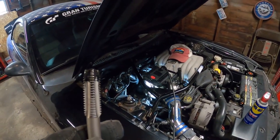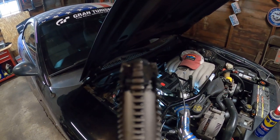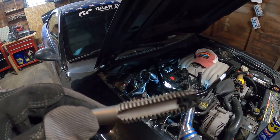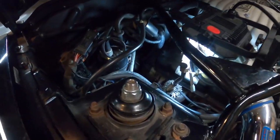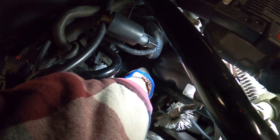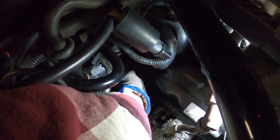Well, it makes more sense why I wasn't able to get the bolt to thread any farther in. This is the aftermath of tapping it. There's so much carbon buildup in there. Man, I'm glad I'm doing this and didn't just try to force the bolt in. Got the threads all cleaned up, and now I can just thread the bolt in there with ease. And if you're wondering, and if you want to do this, a 1-inch bolt will work, and it won't run into any issues once it's in the head.